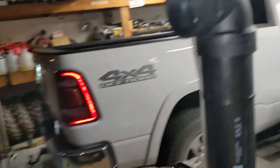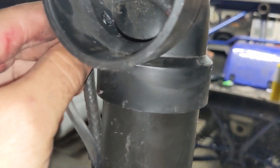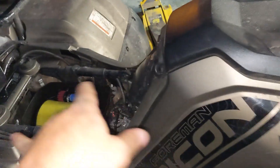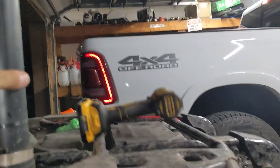The diff fluid was pretty milky as you can see from my demonstration of spilling it. The rear wasn't as bad but still pretty milky. I went ahead and moved those vent lines — the only one still up here is the radiator because I don't want coolant spraying in my face. This vent line right here is now front diff, rear diff, and fan all in one. Someone suggested running all vent lines into the air box — you can totally do that, but you have to run them across the motor, which risks melting, and you have to add holes to the air box which could cause leaks. I used to do that; it's a nice way to do it, nothing wrong with it. The black is front and rear diff and the pink is obviously the fan. I also added a big zip tie here to tie this into the fender liner for more support. The snorkel is even more stout now. Now all you've got to do is put oil in the diffs, put the air box cover and seat back on, and go ride it and abuse it some more.